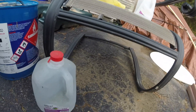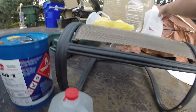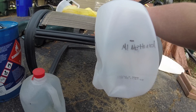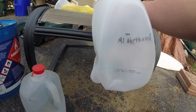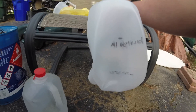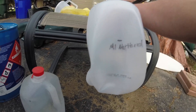You're not going to get it dead-on or perfect every time. If you're going to go over or under on either the distilled water or the methanol, I usually try and add a hair more methanol, just because distilled water obviously doesn't have an octane rating, so I'd rather be running a little bit rich than a little bit lean.